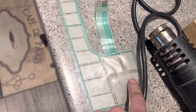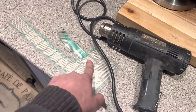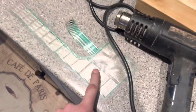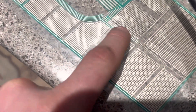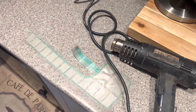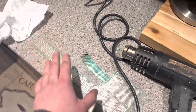All I did was peel those plastic pieces off — look at how messed up this was. From sweating or a water bottle, moisture got up and in here. I separated it, used a cloth, and pulled out a lot of moisture from between these buttons. I resealed it with a heat gun, which pulled out any last bit of moisture. You can see the contact lines right here — it looks like it was shorting before. I want to make sure those contact lines are nice and clean. You should have straight parallel lines without making contact across multiple buttons. There were literally water bubbles in here, so we got all that out.